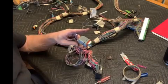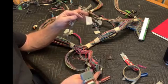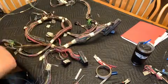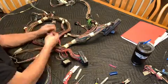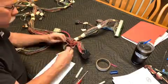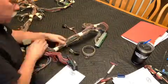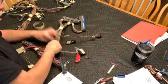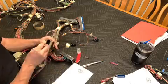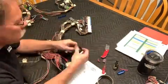So here I'm just showing you that the wires that I took out of that C100 connector really just go right back to the Tach Module connector, which is what we're looking at. It's one of the damaged ones, which is why that housing is missing pieces. And here we are just progressing through, taking out a few more of the wires. I told you earlier we left the starter wire, but there are also additional wires for the air conditioning compressor. While I won't be using the original compressor, I'm going to leave it in the factory location, so I may as well just leave those wires in. When they're up near the top of the harness, up there near the ECM, I can then tie those into my pressure switch or wherever I need them to go for use in the air conditioning later.